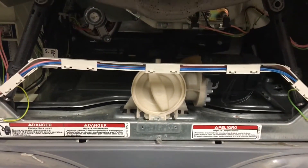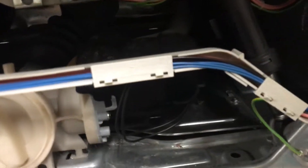It started happening — I noticed when I put it on a rinse cycle, this hose right here runs up to the top of the machine, the drain hose, and water was dripping down this hose. So I thought, okay, my drain hose is clogged or something, it's not draining properly. I lifted up the hose back here that goes into the drain, and nothing was draining out. So I took that off, ran it through the sink — it's not clogged.